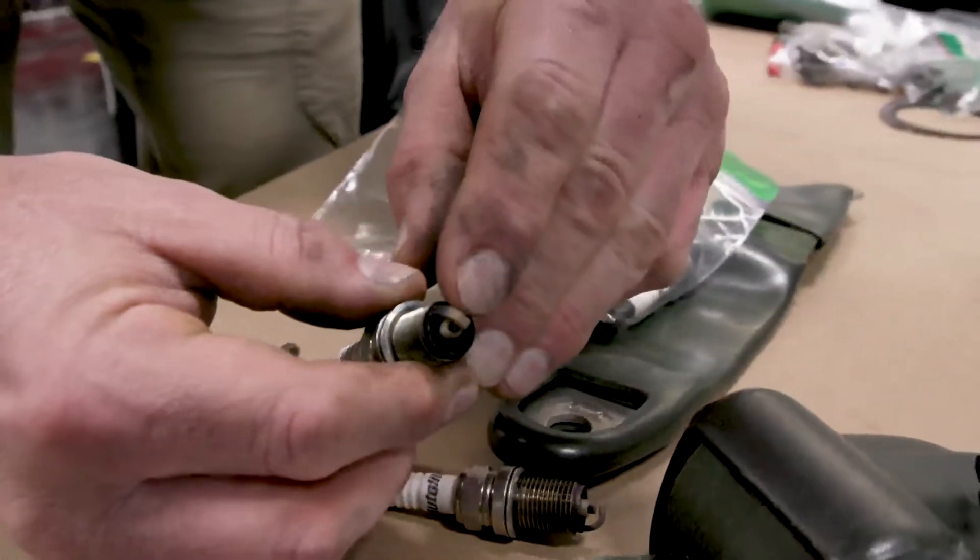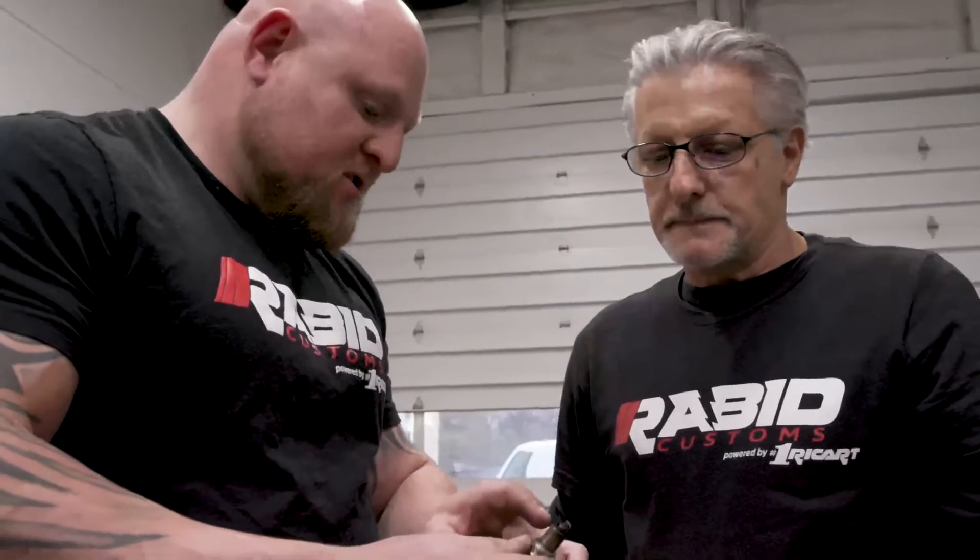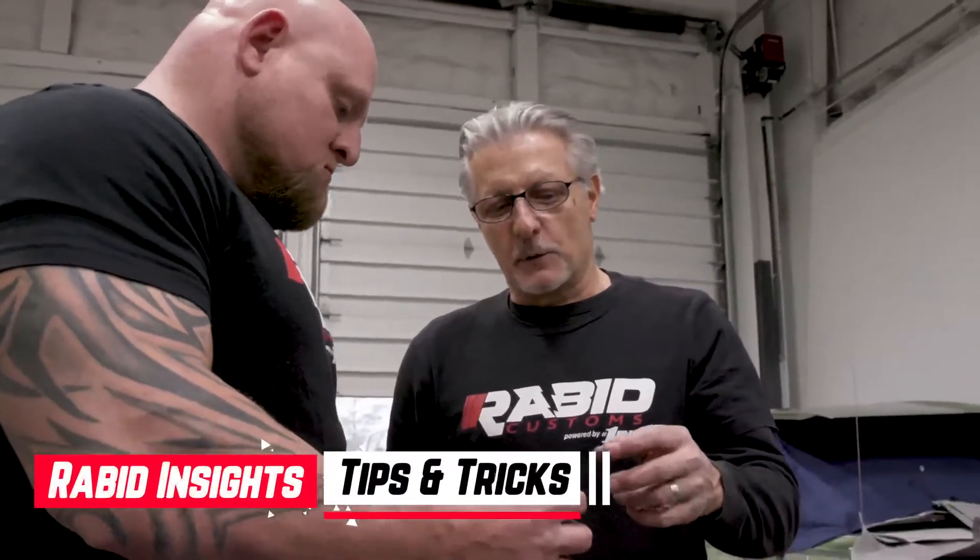So if you advance the timing, it goes down. If you retard the timing, you'll see that burn go up. Let's look at some variables here — that engine's still in the car. I wanted to make the most power I could make out of this engine. Does it need to be a little leaner and not worried about reliability? But we've been idling. When you idle, it's a little richer.